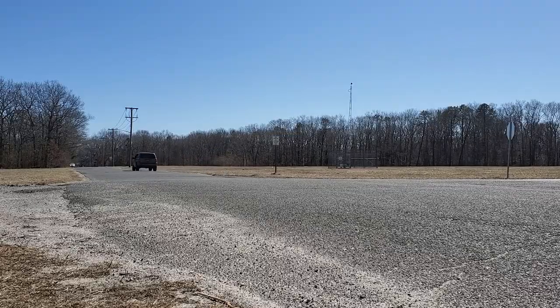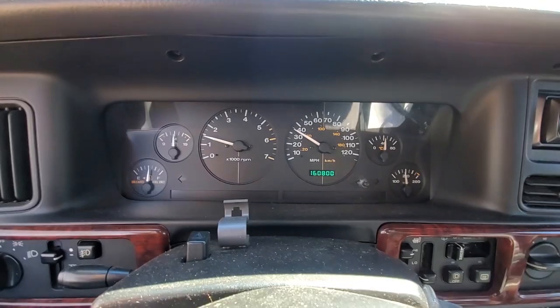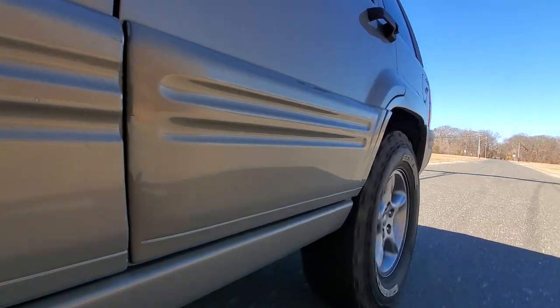Here we go — 40 miles per hour, then down to 10. That's very important: you don't want to stop completely. Find a place that doesn't have any red lights. Now going to 35 down to 5, less aggressive braking. We got a stop sign with some cars coming so we're just going to feather the brakes — we do not want to imprint the brakes with a hard stop, not just yet.